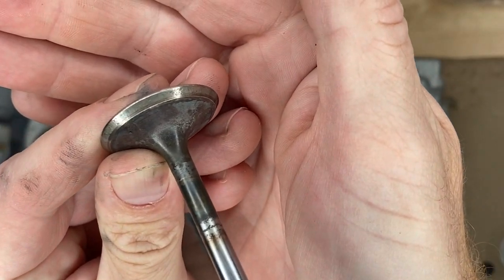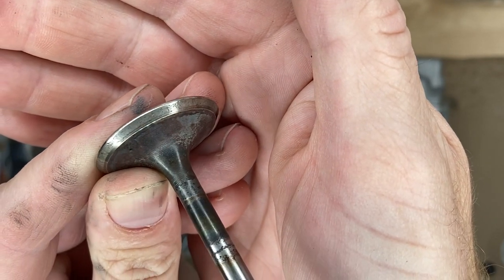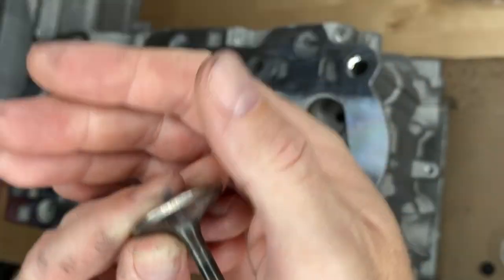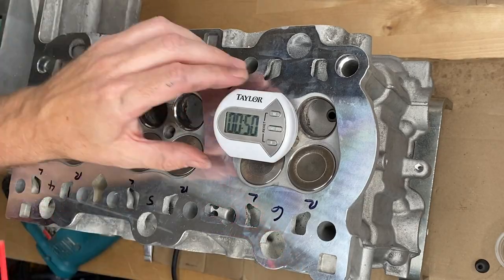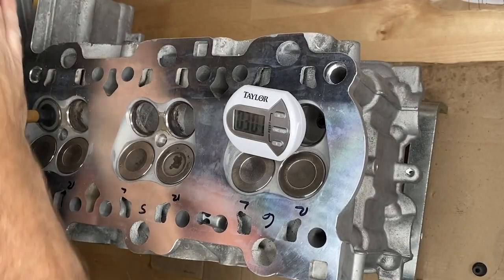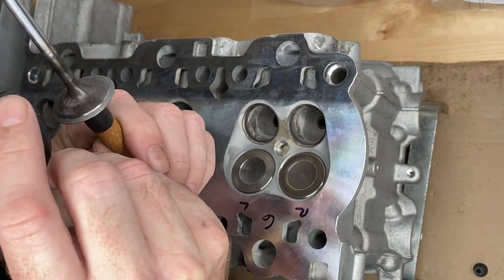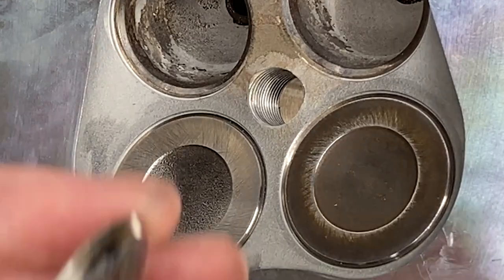And then that made it just as smooth as all the intake side valves. Next up — look at that. That is pitting. That is not good. Many of you said that I should replace the exhaust valves. I don't disagree, but I do want to see if they're saveable. So we're putting some WD-40 down the valve guides just to lube our lapping job.